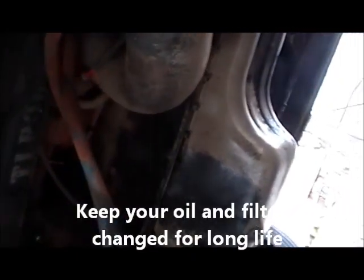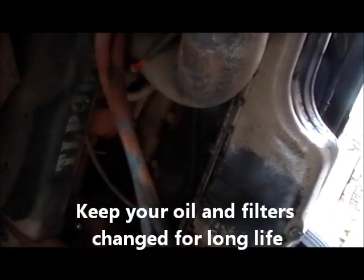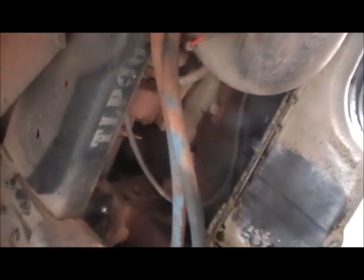That's what it is. Now I've got 217,000 miles on this. It's got a Cummins with an Allison transmission. There's the transmission right there, back there. But it's a Cummins, and another reason why I wanted the Cummins is you can replace the cylinder sleeves and make this back to spec. In other words, it'd be back to like a new motor. It's not like you bore it out. You just replace the stuff. Now it's costly. Everything's going to be costly in this thing.